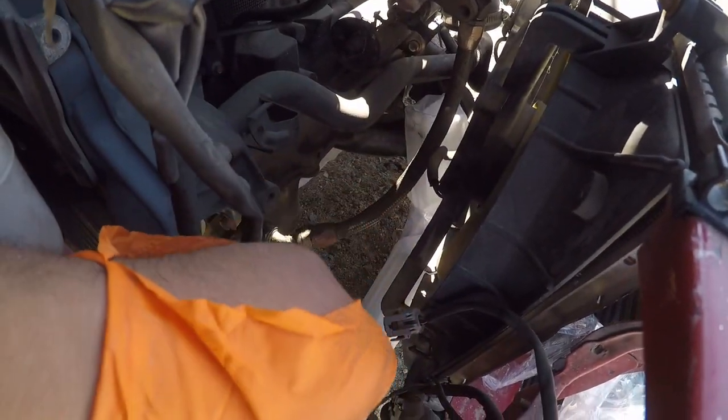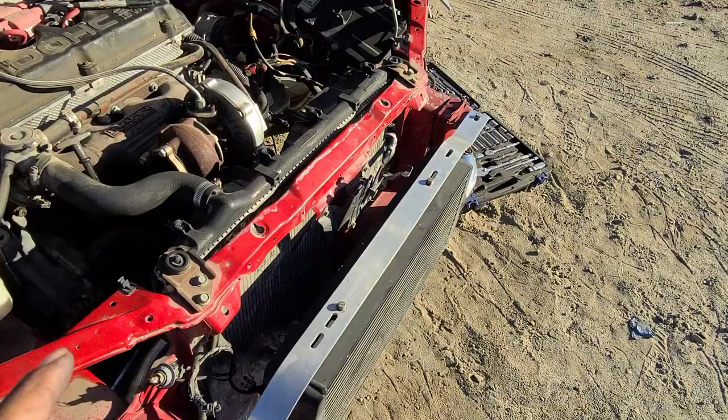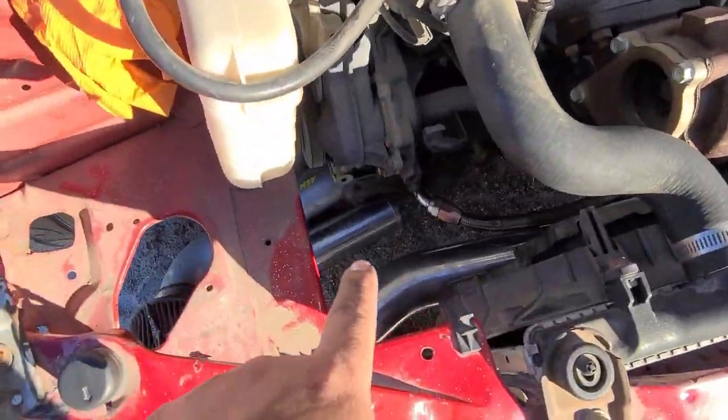Now we're gonna go down this side. It's gonna curve this way, another U. We're gonna have one coming down the turbo down this way. All right, so as you guys can see, it's taking me a really long time to get this piping done. So I'm gonna go ahead and cut this video into two parts. Pretty much we have the upper intercooler piping done from the intake side, and now we gotta finish the piping that goes down to the intercooler.